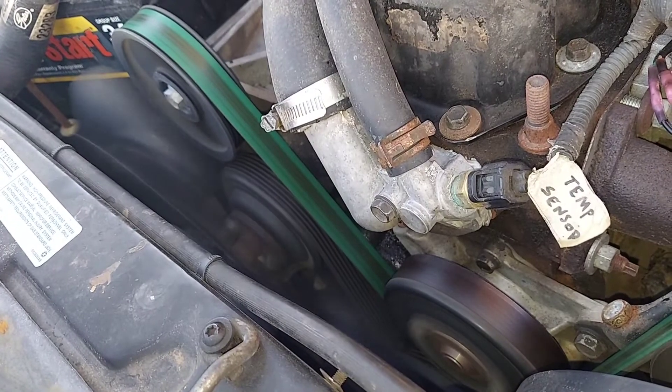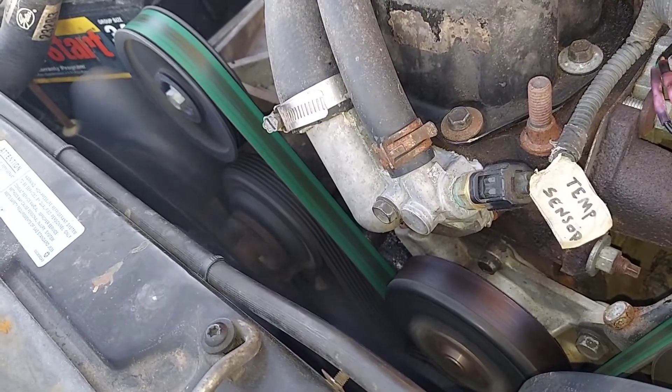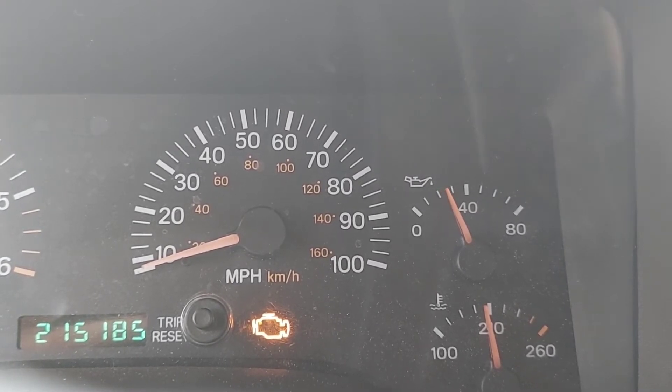The water pump and mechanical fans spin faster, pumping more coolant through the engine, which keeps temperatures down when there's no natural airflow through the radiator. Raising idle also increases oil pressure, so keeping oil circulating through the engine will extend the 4.0's already impressive longevity.